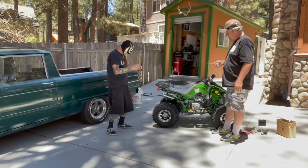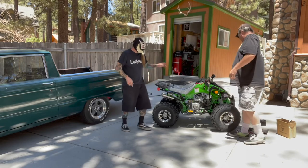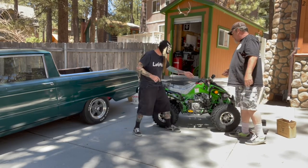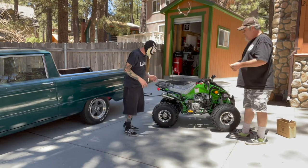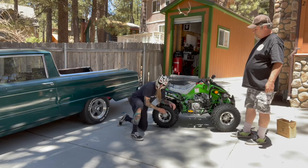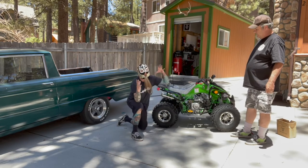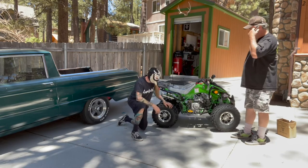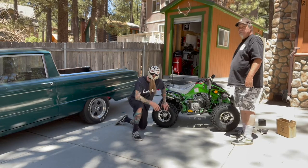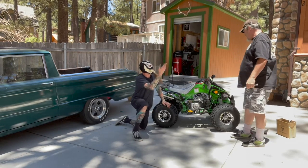Okay. So we got it down, got the wheels on, got the back rack lined up, and the front bumper put on. We still got to go around and tighten everything up, like the handlebars, the bumpers, the rack, and everything. But thing to note, people, when you air up your tires, they have taken the Schrader valves out from the factory so they can compress the tires low enough to fit in the packaging. So you're going to have to tighten the Schrader valves up, otherwise all your air goes out.